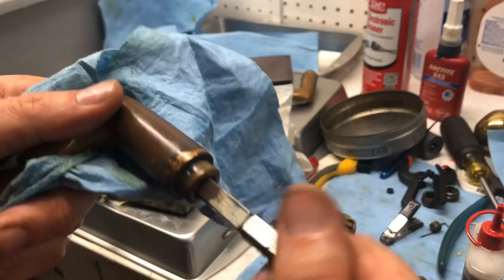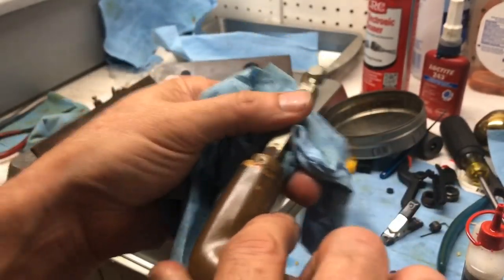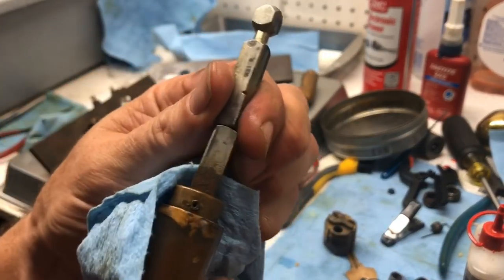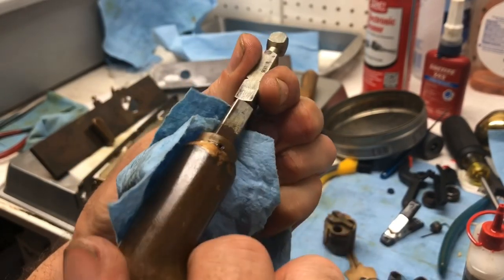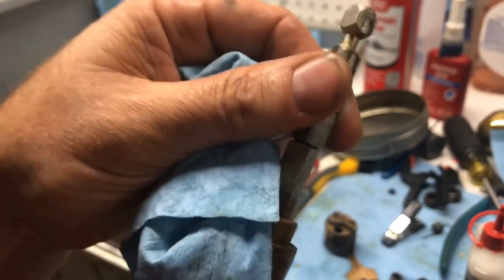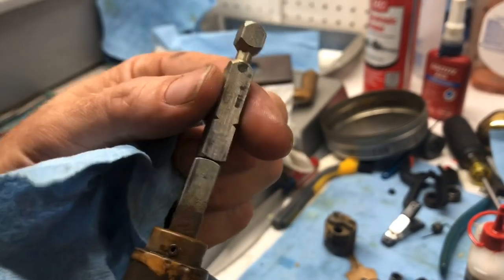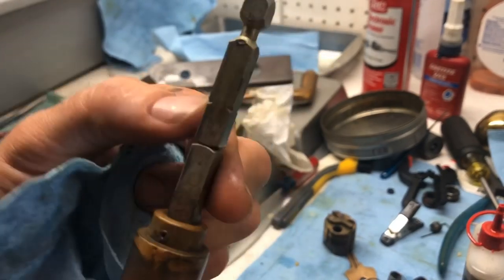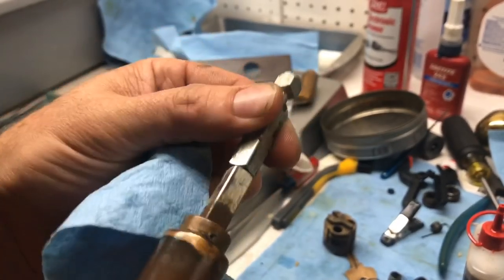So in this case, let's see, this would be the exterior. And if it was tightened all the way down like so, when you go and you turn it, it kind of grabs. So instead, you go tight all the way, back it off till it's square, and then go one more revolution or one quarter turn because it's four-sided. And that gives you the leeway to go down.